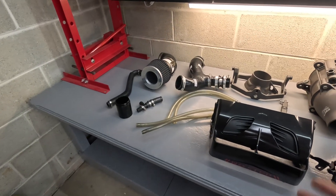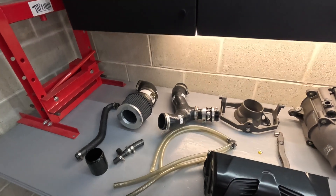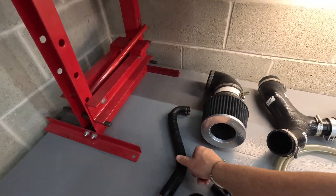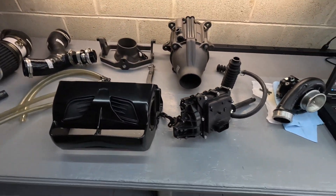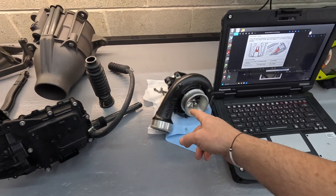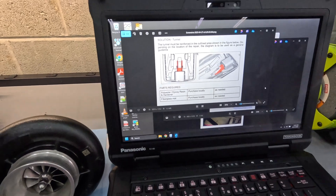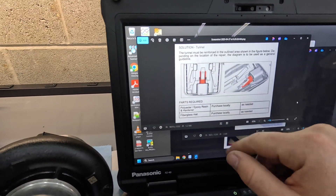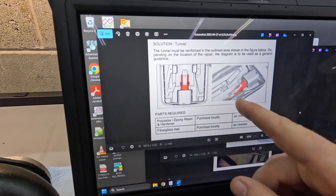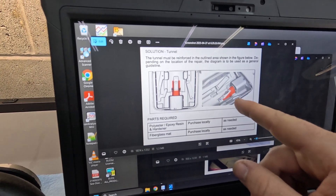It's crazy that it doesn't even look like it, but this is everything that's come out so far. Obviously we have the intake intercooler hosing, the bailers, one of the freshwater feeds that comes out from the back of the jet pump area, and our IBR. Just to get a little bit more room, I also took out the supercharger. This is the area that Sea-Doo recommends for reinforcing the jet pump tunnel — you can see it's either side of the tunnel as well as some structure over the top.